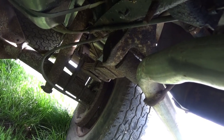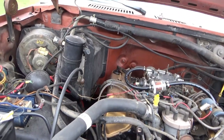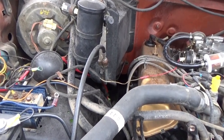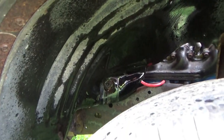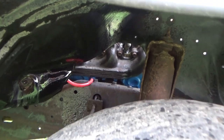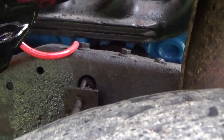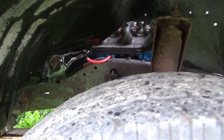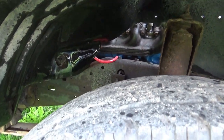Because I've pulled the axle to get to the rear shoes. You might be thinking that back there was the only leak — well, sadly, you'd be mistaken. Right down in here, all the wetness — that's what I was hearing spray. I can't tell if it's right where that steel line comes through there. But what we're going to do is probably get a new rubber line and just replace both of them while we're there. It'd be silly not to.